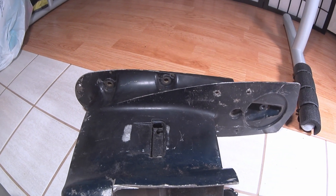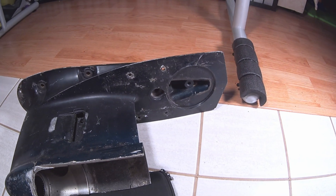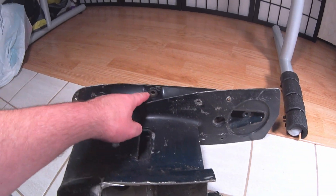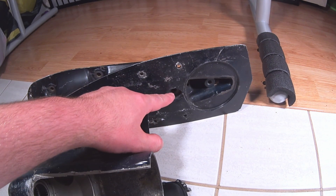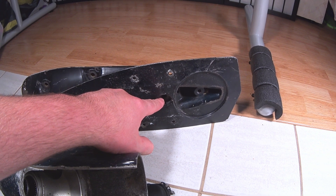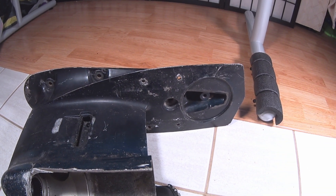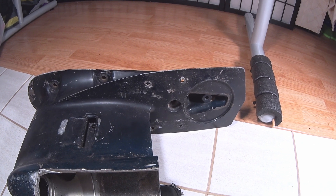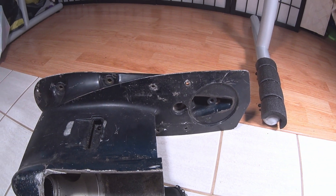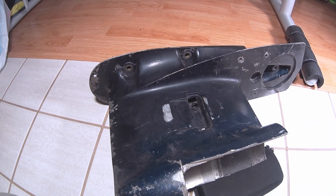But overall, even with four bolts, technically it will still work fine. This is just a quick tip on something to avoid, because it is easy to rush. These bolts are always easy to remove, and then you realize you have one more left and this one just doesn't want to come out — and then it turns and snaps. I have seen this happen more than once. So just keep an eye on it. If you remove it first, you really don't want to cause stress on this bolt by splitting any other part of the lower unit. That way you can hopefully get it out easily.